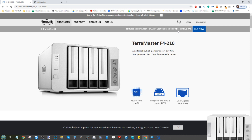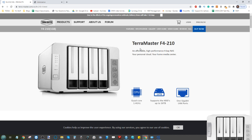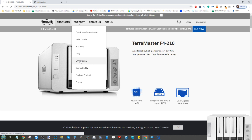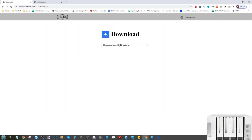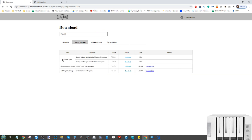After giving it five to ten minutes to boot up and scan the drives, head over to the TerraMaster website, go to the support section, drop down to the download option, and look for the available downloads. You can search for your specific NAS model — in my case the F4-422 — or just navigate to the core software we need: the desktop application TNAS. It's available for both Mac and Windows, and it's small and easy to download.